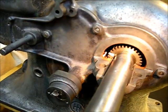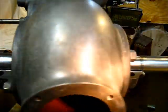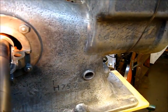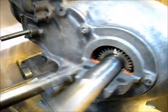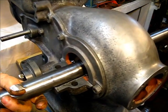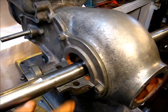On this side of the engine, it's quite easy to see when those three teeth line up — quite easy to verify right there. You can also see it on the other side. You can look through this right here and it's readily visible on this side too, so you can verify it. Now that we've verified the timing in the crankcase is correct, we can assemble the shims and the bearing caps.